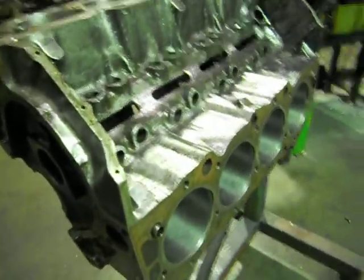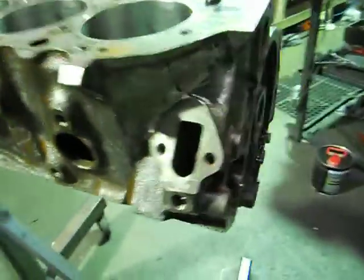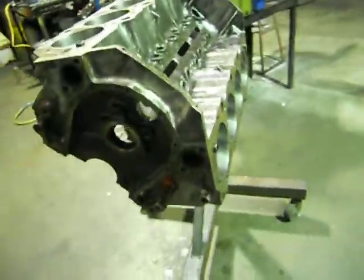Got our bearings here. While we're waiting on our pistons, I've given the block a going-over just to de-dag — just to take the rough casting off it. It's not fully polished, but just to take the rough stuff off. It had big casting flash marks everywhere. I've blended it all back. It had big dags here and there, so it's all been rounded off. When it's all finished and painted, it'll look really nice. I've done a bit of work around the front there, and just in the valley — they have a lot of casting flash real rough here. Take all them off, as it just reduces them breaking loose later and going through your oil system and picking up bearings.